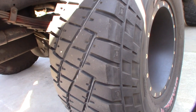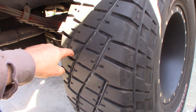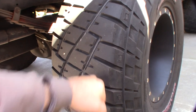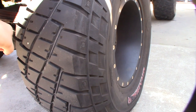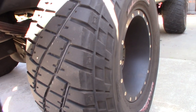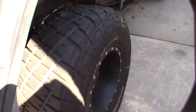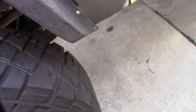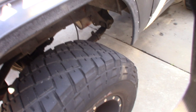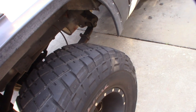This thing is a pretty slow leak. Like I said, this is not the preferred method. I'm just going to rip that nail out. There's some air in here so you've got to be careful. Then you grind a hole through it. I've done this before on a couple of cars on a road trip. This thing will leak out within a week or so — it really depends on whether I'm directly on the nail or not. If I'm not on it directly, the leak is a lot slower.